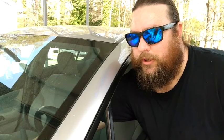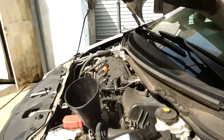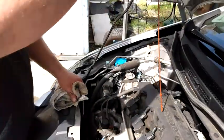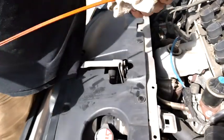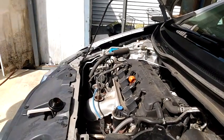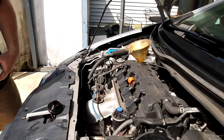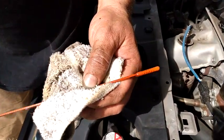We've started it — now we're waiting for the oil light to go off, then we're going to shut it back off and check the oil. Let it wait 30 seconds or so to make sure everything's drained back into the crankcase, then you can check it with the stick. You can't take the reading right when you first pull it out because with the engine running, oil will be higher. You can see it's right at the cross-hatches. I'm going to put just a dab more in — it looks like it brought it right up to the top of the hatches, so it's right on the money.